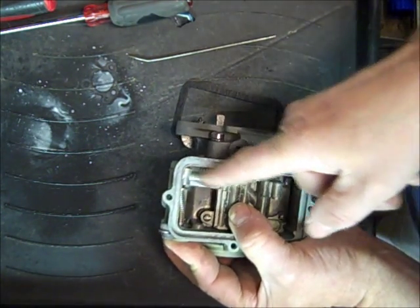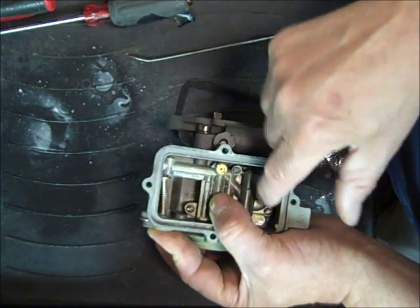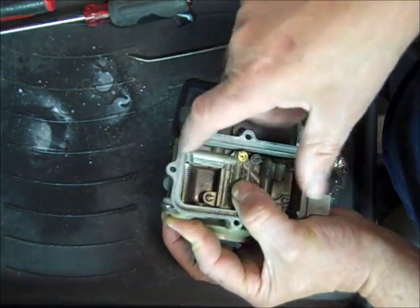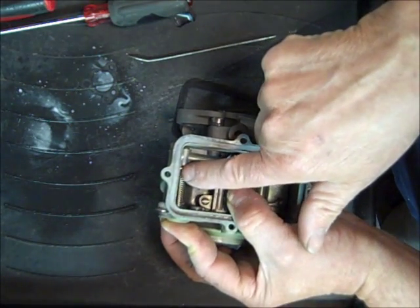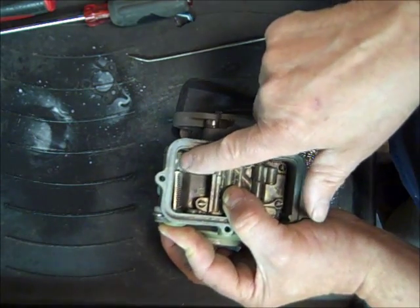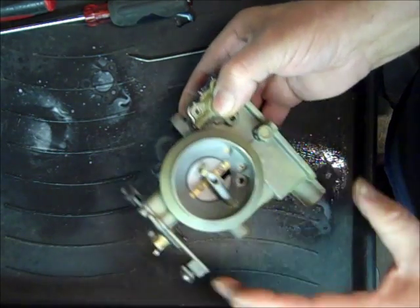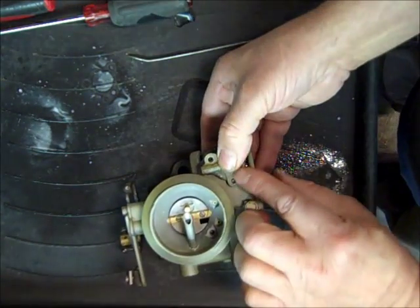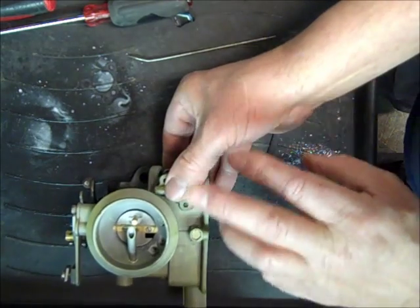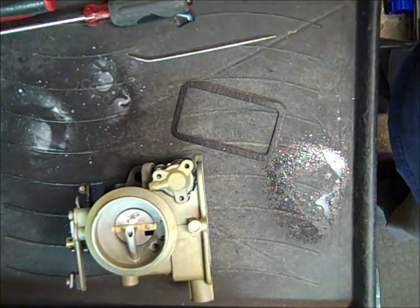It cuts off the fuel from flowing in here, and then as you press on the accelerator you get a little spurt from your accelerator pump, but after that you still need a bigger volume of fuel at high speeds. At high speed your carburetor has less vacuum, so this thing falls down due to the spring, pushing down on this little shaft and letting your gas flow — that's what that's all about. I'm going to stop the video here, make the next video, and put the rest of it together. I like to put new screws on these, so I'll do that off camera. Thanks for watching.